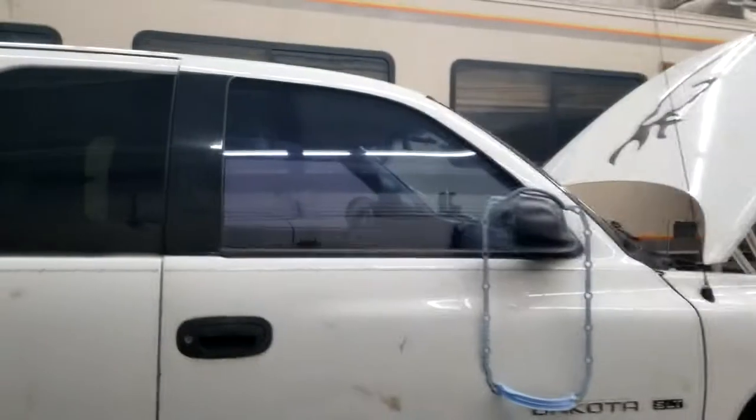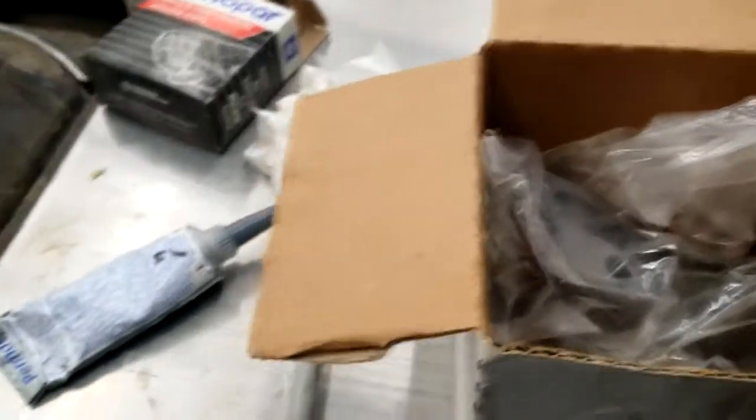And before I start, I'm going to unplug the coil, which I think I already have it unplugged for some reason. Yeah, I already got it unplugged. And I'm just going to crank it with no spark and hopefully prime the entire engine that way. And also, I might be able to get a reading off my oil pressure gauge in there to be able to see if it's doing what I want before I actually go and fire the engine. So I'm going to fill this thing up, get it in there, get it torqued.